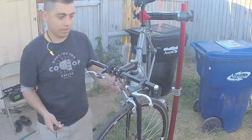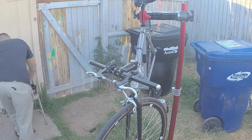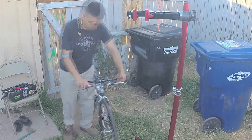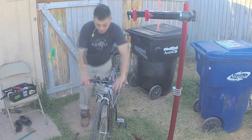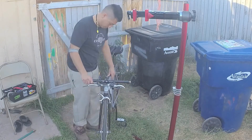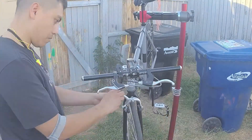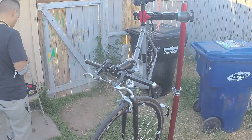Installing the brake cable and tightening it. When you tighten the brake levers, make sure that they are angled at a 45-degree angle downwards. Depending on the geometry of the frame or your comfort level, you can adjust them accordingly, but they should be even.